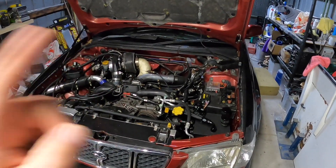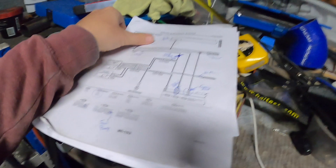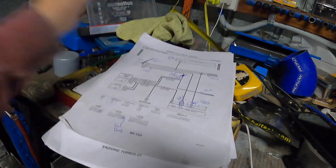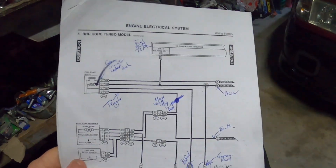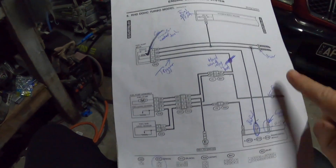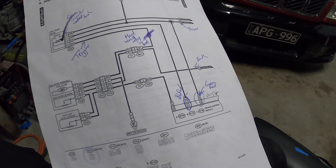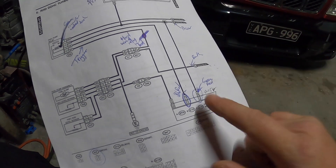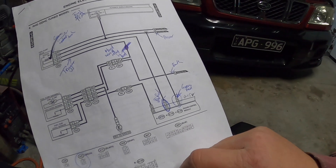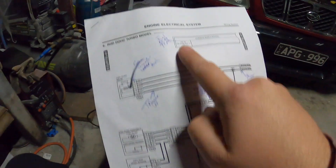I got into the car looking at the engine electrical system. Let's start from the basics - power to the ECU. I deep-pinned it and checked it on the multimeter, got 0.05 volts. So I traced it back to the power source: fuse number 11.